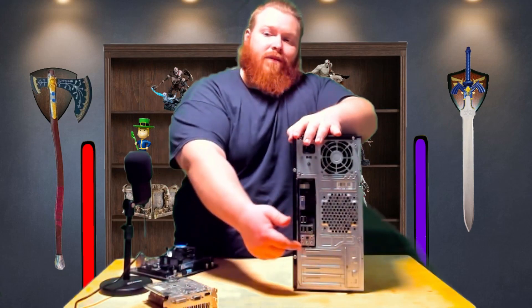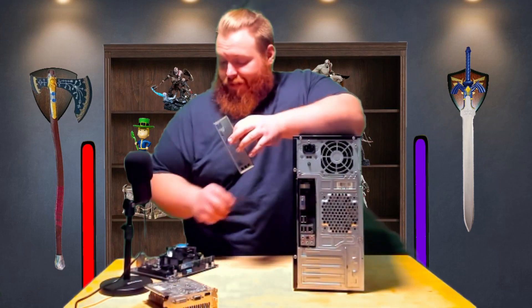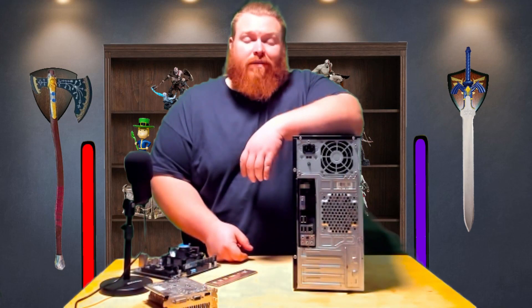You may notice that all the I/O right here is kind of weird and jagged. This case, because it's Dell and they only ever planned to put one motherboard in it, had the I/O built into the case — it was not a removable I/O shield. Many motherboards come with a separate I/O shield that you press into the slot and then mount the motherboard up to it — it keeps you from bending components around. Since this had it built in, I had to use an angle grinder and a whiz wheel to remove it.